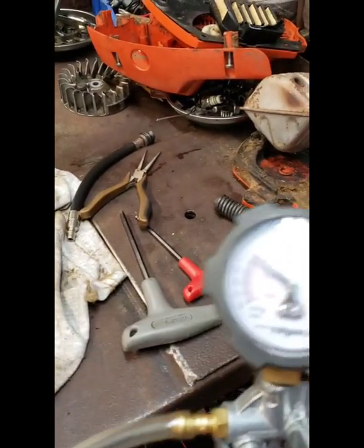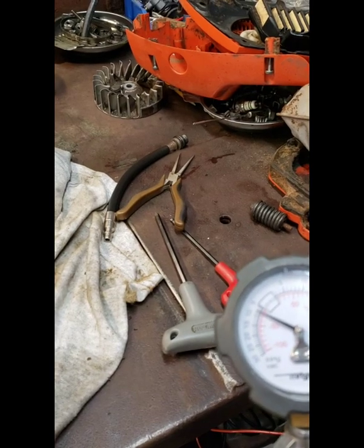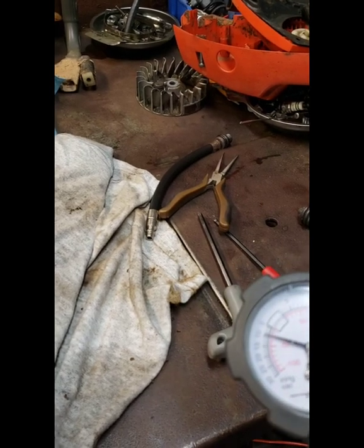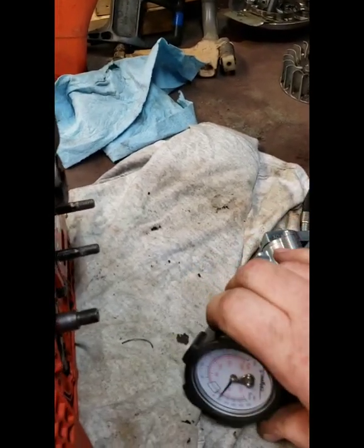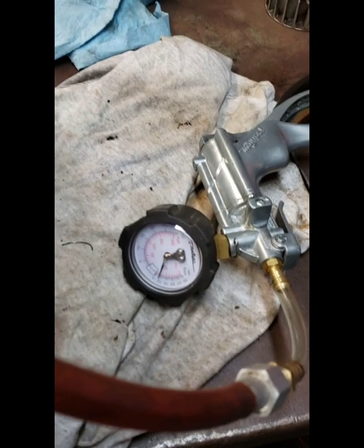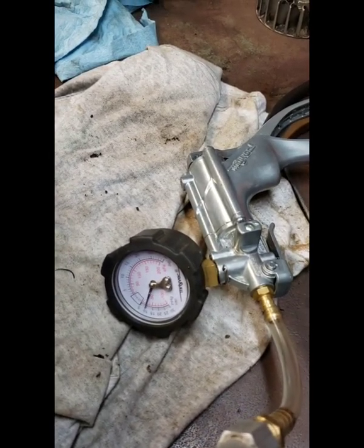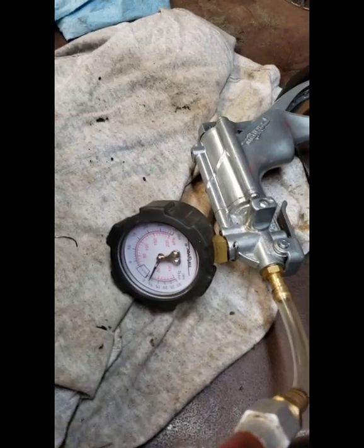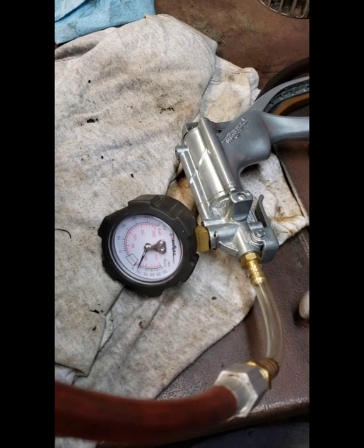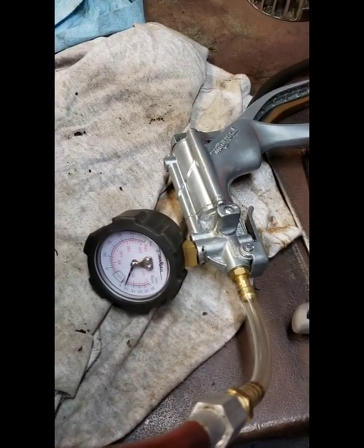We'll relieve that, we'll switch this over, and we'll pull a vacuum on it. Right there is about nine pounds — I usually do eight to ten pounds in that range. And right there, what you see is the pulse signal while I'm rocking the crank, and it's staying put. So that's going to be a pass.